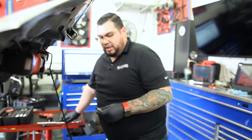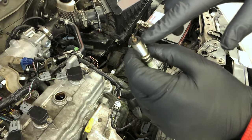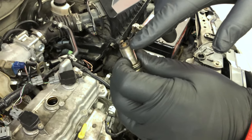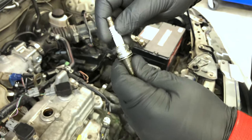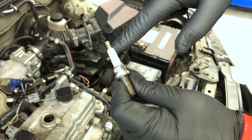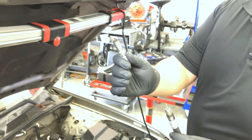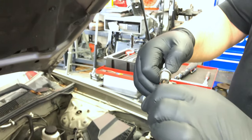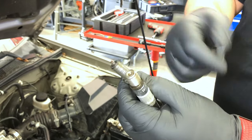When you remove the spark plug, this is a good time to check it for its health. We're looking for the electrode — this one's actually quite dark. Pay attention for any oil, fuel residue, or coolant residue on the tip. Also watch the porcelain: if you see black markings going up the porcelain, that's an indication that spark is traveling along the porcelain to ground and the plug needs to be replaced. Also make sure you select the right adapter for your compression test — match it up to the spark plug length. If you pull out a short spark plug and use a long tip, that tip could enter the cylinder and damage the piston.